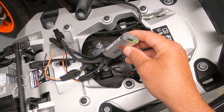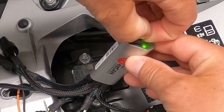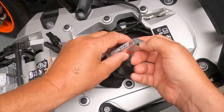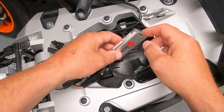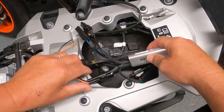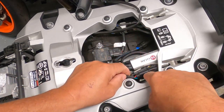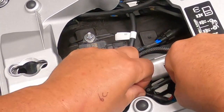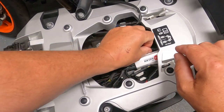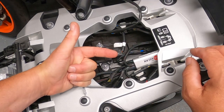To complete setup, plug the small USB-style cable into the EasyCAN and connect to your laptop — Windows or Mac — then go through the registration process and update the software. That takes about five minutes and I did it before connecting to the bike. The kit includes a spare blanking plug for the port as it's easy to lose. Final cable management: tucking all the wires and blanking plugs under the base plate, and the RDC plug is tucked between the two BMW plugs.